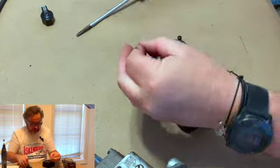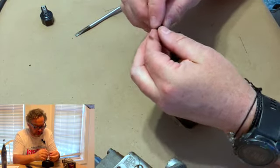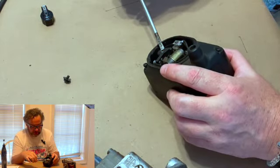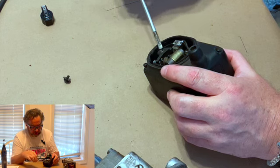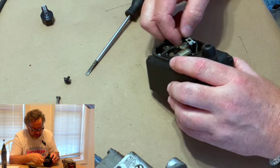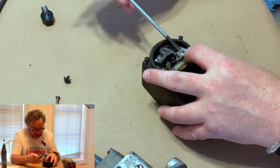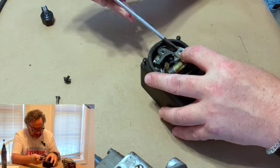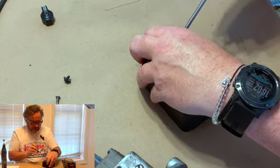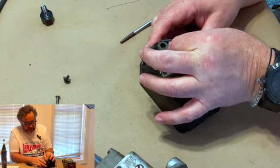And on Wico's, and this is just Wico's, it's not Fairbanks Morse, it's not International Harvester, but on Wico's, you'll see that I took the screw out here. That screw is actually what holds this set of breakers in. It also, when you take it out, there's a bushing and a spacer, and the spacer looks like a washer, and people make the mistake and leave the spacer out.